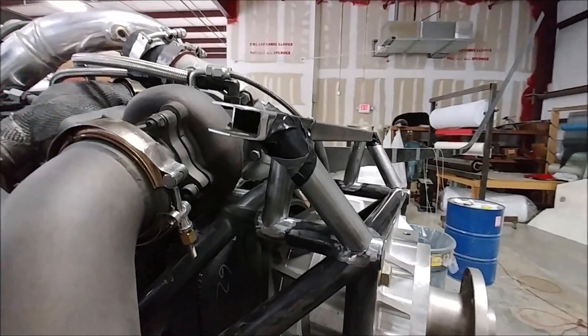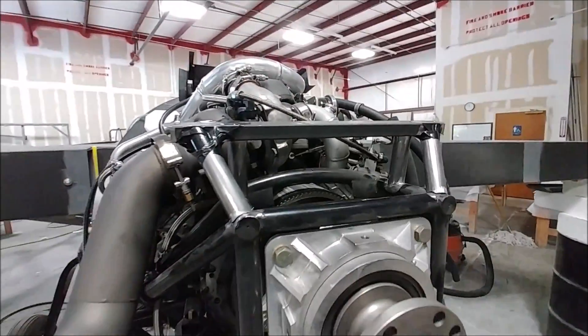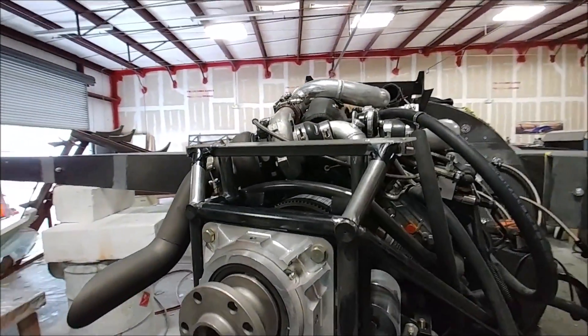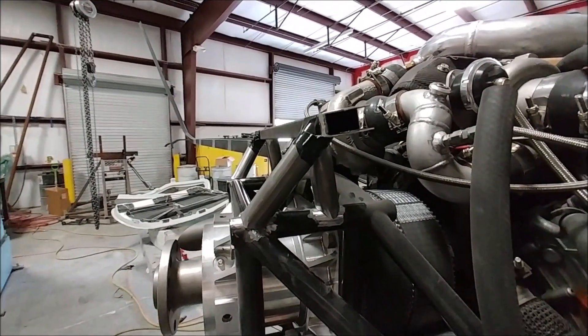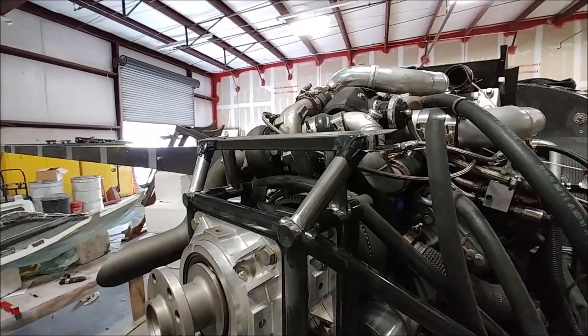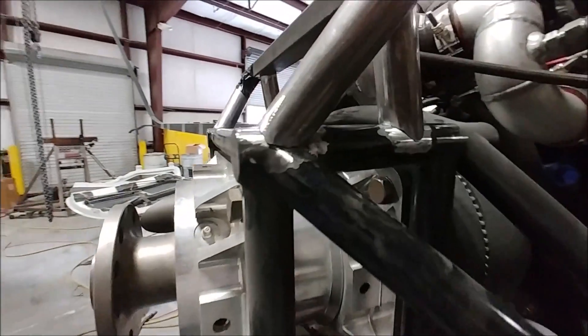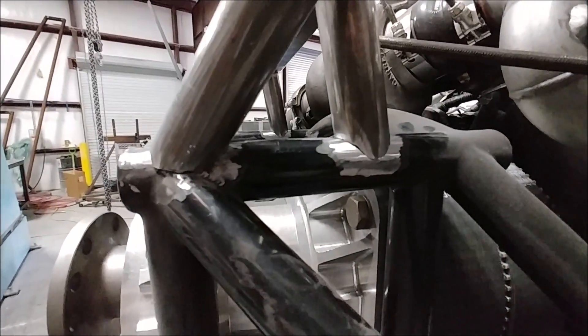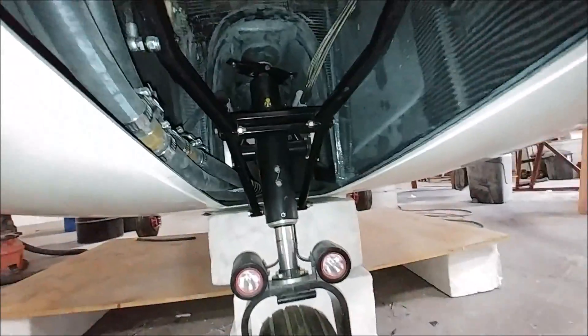That's the second one, and now we're on to Friday. I finished fitting that extra brace for the engine mount — you can see it's just basically sitting there with a little bit of duct tape holding those angle ones, but it's ready now for Brit to come along and weld it into place. Then we'll be able to put those adjustable rods that anchor it to the firewall.